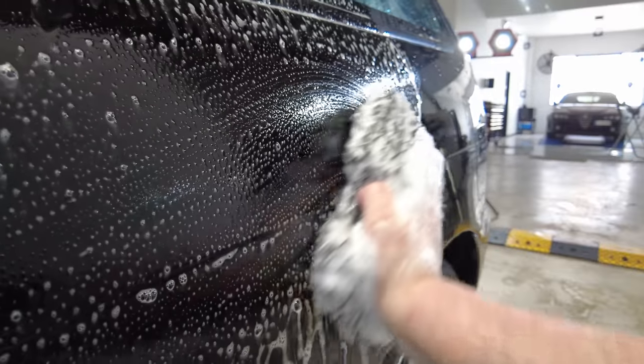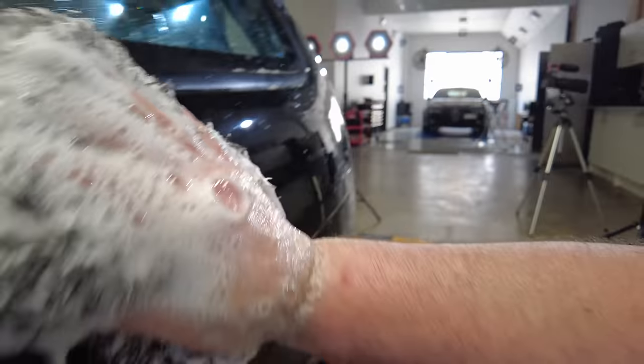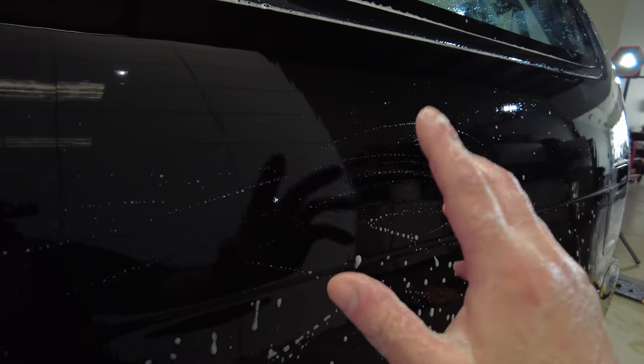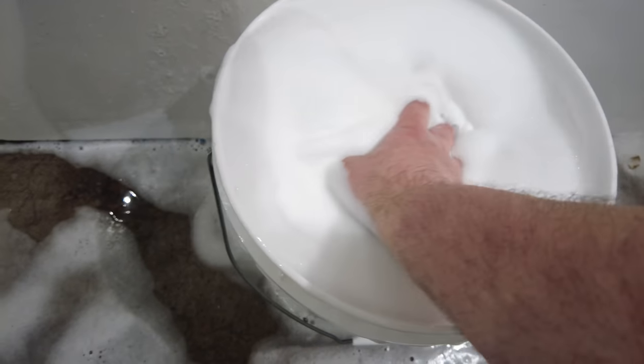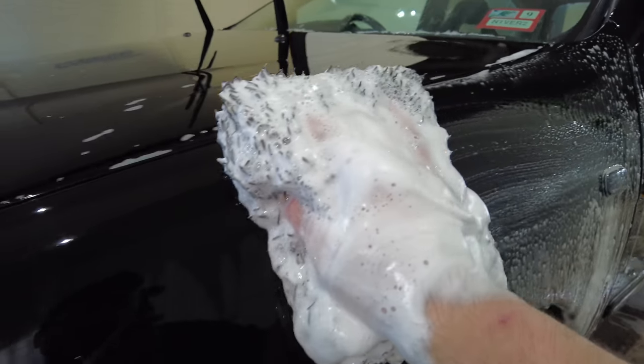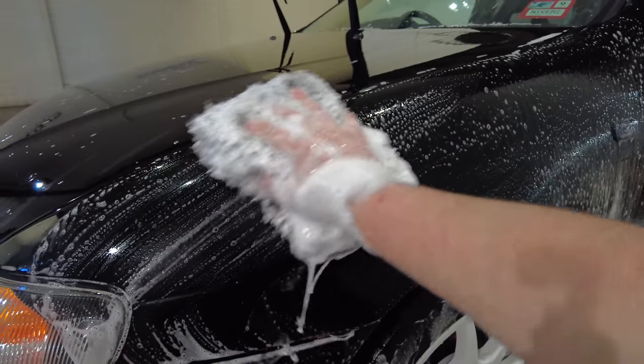So what I would say, if you do want to use it in a wash bucket to make use of Lift's greater cleaning ability, is that I'd strongly recommend still adding some Carpro Reset to it to give you a better consistency, lubrication, and improve the hand wash result. But otherwise, Carpro Reset is still a very capable car wash detergent in its own right. So you may just want to stick to using Lift as your pre-soak foam and Reset as your hand wash soap. The other option is to foam up your car again and then just use that foam to hand wash the vehicle.